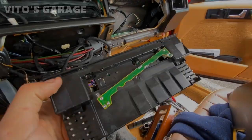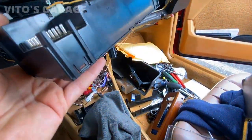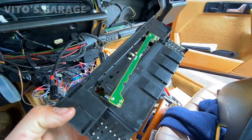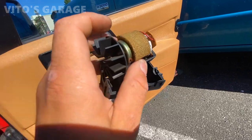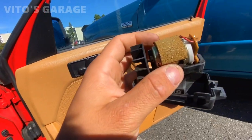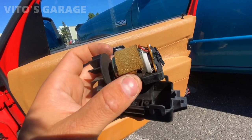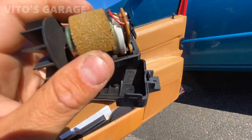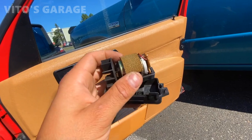It was a pain to remove and take this center piece apart just to replace these two bulbs. I'm also taking this auxiliary pump apart — it sits literally behind the glove box area, so you have to remove the glove box to get to it. Mine was a little noisy, so I'm taking it apart. There are carbon shavings inside — I'm going to clean everything and lubricate this pump so it won't be noisy anymore.